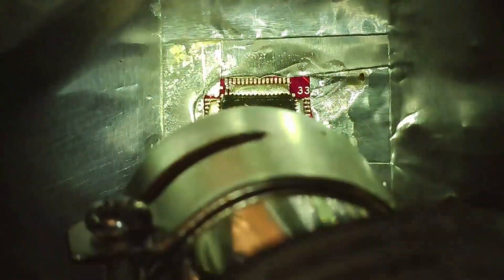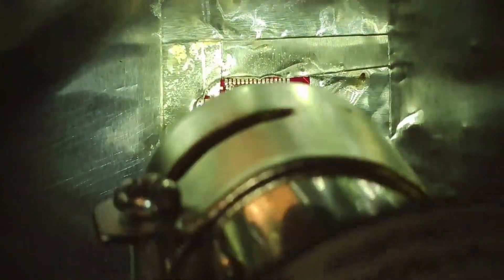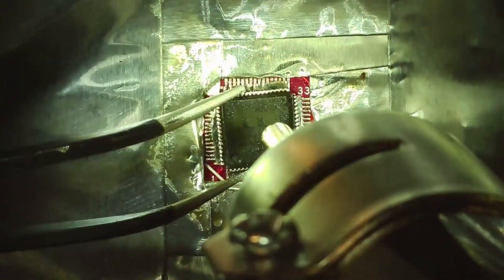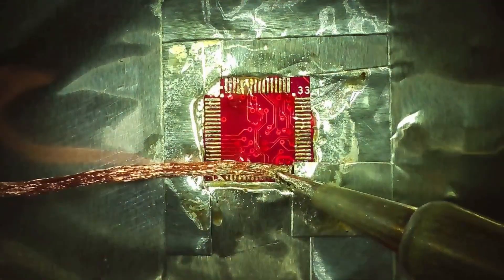I had a small camera mishap, but as you can see, I covered the surrounding area with aluminum tape and applied an SMD removal alloy to the pins of the chip. This makes it easy to extract the chip using hot air. I managed to find the replacement chip for under $5 with just a few dollars shipping on AliExpress — I could not find it anywhere else.